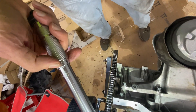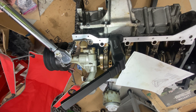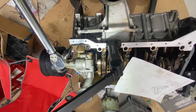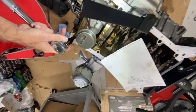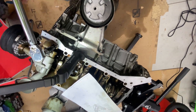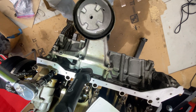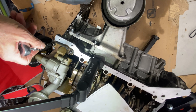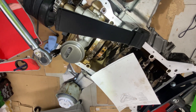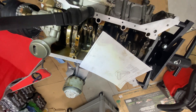So, with a little better light - this is 177 inch pounds. Why do I take so much time to clean the threads? Because I'm not torquing this down to 100 foot-pounds; this is 177 inch pounds or 20 newton meters, so I want to make sure this is done accurately. I always like to torque things down progressively. I believe this is an aluminum block - this is not the time to ruin something. Click. And we do the same thing over here. Click. It seems people like to click two or three times; I figure one and done, but I'll do it twice.